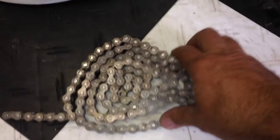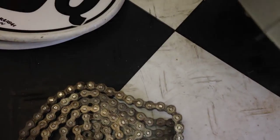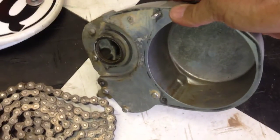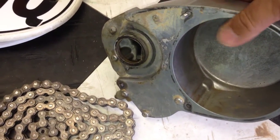So over here's the chain. I cleaned the chain with some solvent really well, and then we'll put it back on and give it a good lube. The shift cover — inspect it, make sure there's no dirt or mud caked up around there, and then give that a good cleaning and some grease in there.